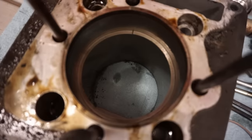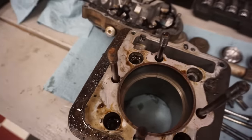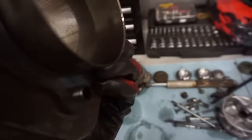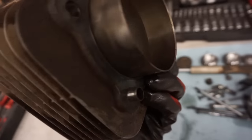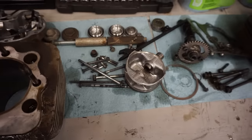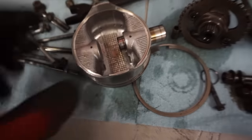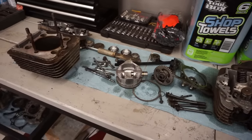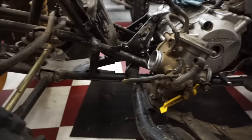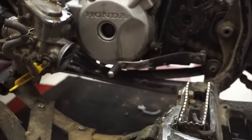Let's rotate it over and see what the crank looks like. The rod bearing looks fine - no up and down play, just a little side to side which is perfect. You're not going to believe this, but this thing is actually a 440. Piston size is right at 88.72mm and 89mm is the 440 spec - so it is a 440. Stock is 85mm, so it's way over-bored, and this is the stock cylinder. The ring gap isn't even that big - worn but not horrible. Maybe the valve seals were leaking.